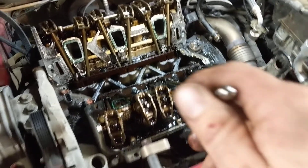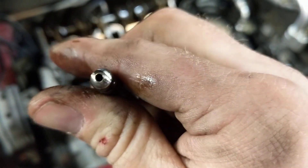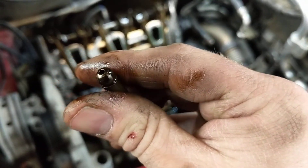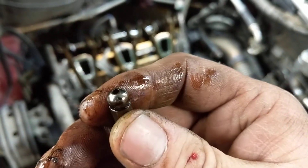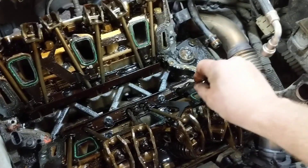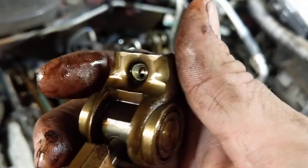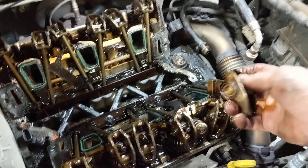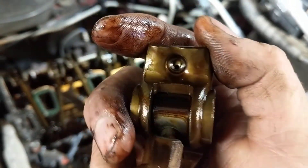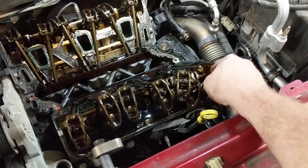One thing you want to keep your eye out for is particularly this situation — see how it's got a weird eyeball-looking effect? That eyeball effect means that this pushrod is junk; it's worn out. It should look like this guy here — a nice, shiny ball without that eyeball look. When that happens, it also wipes out the rocker arm. You can see this rocker arm has a really goofy wear pattern, versus this one which is nice, shiny, and smooth. If you have that situation, be sure to replace the pushrod and the rocker arm together.